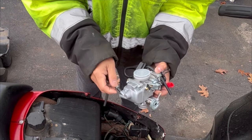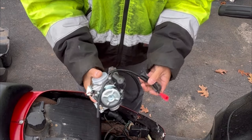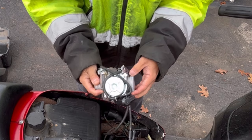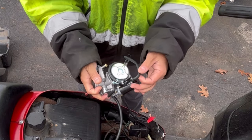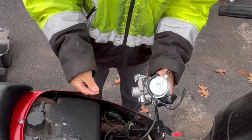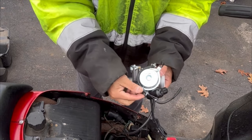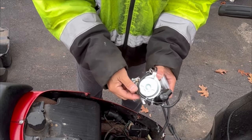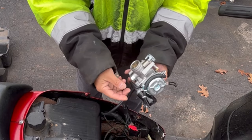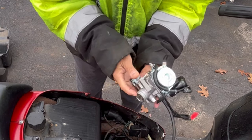I don't know if I should install this line at all because I don't have it on the old one. Here's the intake one which I'm going to attach the intake to. This one here is for the cone filter — it goes into a T-line that goes to the intake. Extra fuel or whatever can be reused or burned in the carburetor. You don't really need that stuff, but you can just bypass it and attach it directly — it has to go somewhere, so I'll connect it.